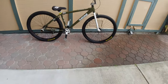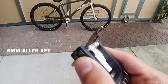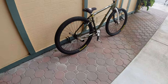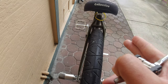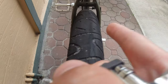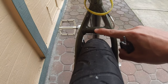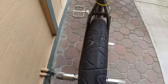The main tool you need to adjust your brakes is a 5mm Allen key — Allen wrench, whatever you want to call it — and maybe a Phillips head screwdriver. Before you adjust your brakes, make sure your wheel is centered and lined up correctly. You don't want to adjust your brakes with a crooked wheel thinking it's the brakes that are the issue. Line up the center seam and try to get as close as you can to that dot, so you have an even amount of space on each side.